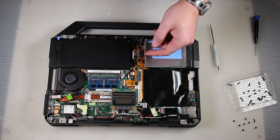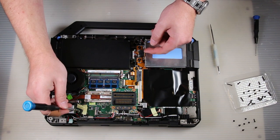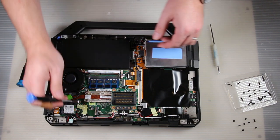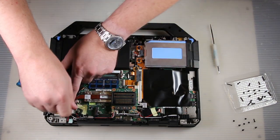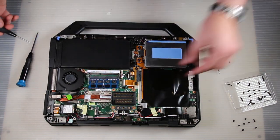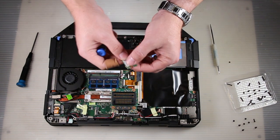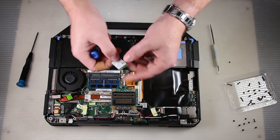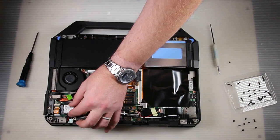This card back here is the Wi-Fi card. It has two antenna cables that just pop off and one screw anchoring it in place. Use a smaller screwdriver here — this is a bit of a delicate headed screw, so you don't want to strip out the head. A spring will let it be removed. It's labeled Wi-Fi or WLAN.